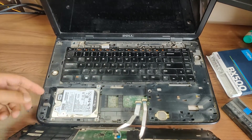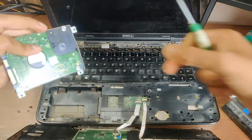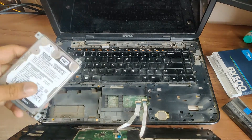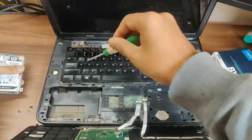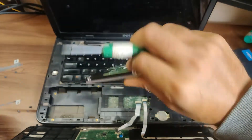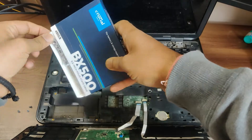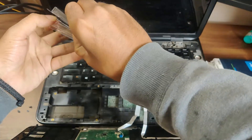I'm removing this now — let's pop it out. It's outside. This is our traditional magnetic disk; you can see it's a WD Black. It's also a faster one because this was a gaming laptop at the time — 7200 RPM, so it's also a costly one. Now we have to remove the case. There's no issue with this hard drive; it's currently working fine, but just for securing the data and faster performance I'm switching to SSD. Let's unbox this SSD. The size is a little bit smaller — it's 480GB, so it gives less storage, but it's faster.